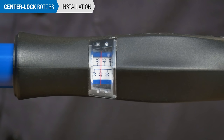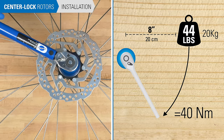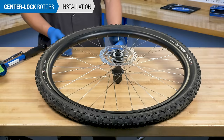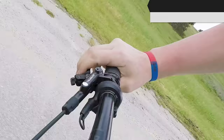If you are using a hand wrench, that is about 44 pounds of effort holding the wrench 8 inches from the lock ring. Use a clean rag and isopropyl alcohol to wipe both sides of the rotor surfaces. The wheel is now ready to reinstall on the bike. After installation, it is a good idea to bed in your brakes. See this video for more information.